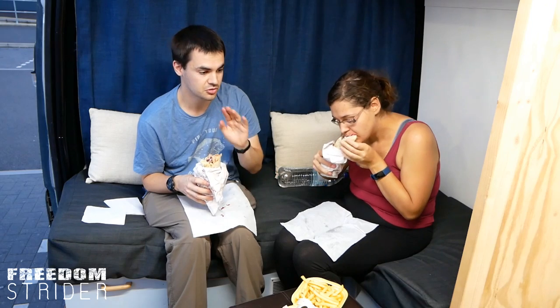The only other option that you could go with, because we don't want a gas fridge, we had that in Scandinavia, no. Drains your gas. And we don't have gas. So the only other option that we've seen people do is you buy a regular £100 household fridge and plug it into your inverter. But that would require our inverter to be on all the time, because the fridge is a 24/7 appliance. So you have to have it plugged in.